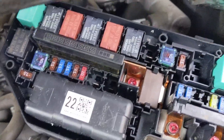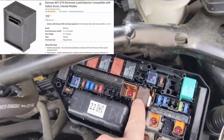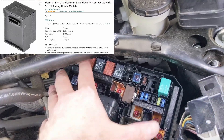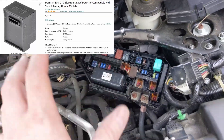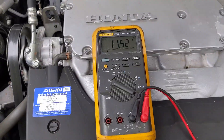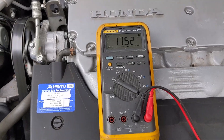The ELD sensor is basically just a current sensor — this little brown rectangle here — for electronic load detection. It's basically a CT that feeds back. If there's something going on with this, all of this has to be taken out to get to the bottom of it, and the connector needs to be replaced and put across the main bus.